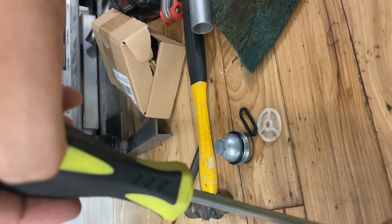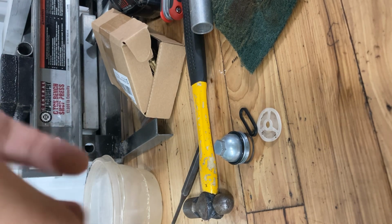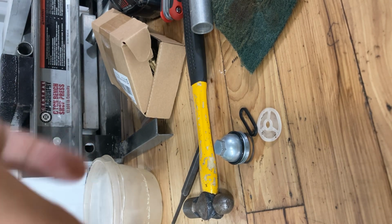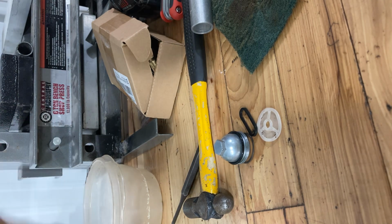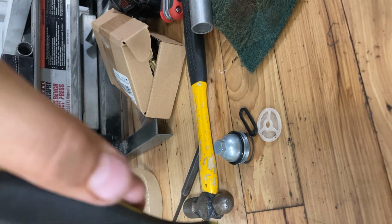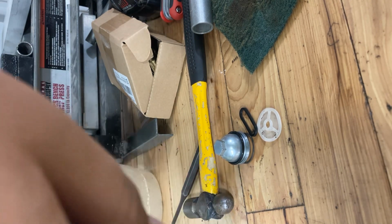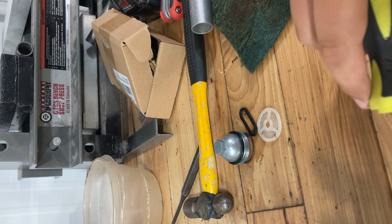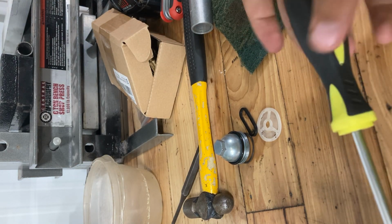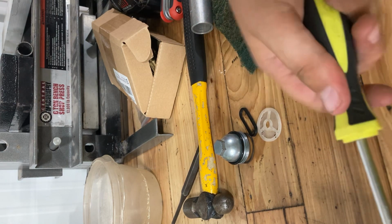Not like my RC cars, though. I have some videos on the channel on that thing. I should probably record the video on fixing it. What does it need right now? The rear end's not working right. Oh yeah, and I'll do a video on changing my four-wheeler's carburetor jet, the pilot jet. So on those DSs, when it gets cold out, they run better with like a 37 in them.